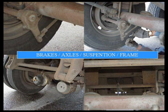Brake and axle suspension stuff. There are indicators if you're doing a walk-around inspection that should give you some indication something's wrong. This one down here, is there anything wrong with that brake compared to that side? It's been caged. You can't cage it going down the road. You may have needed it to move it off to the side of the road when something went wrong, but you don't drive down the road with it that way.